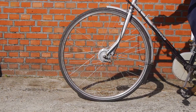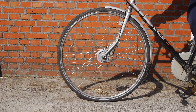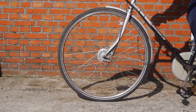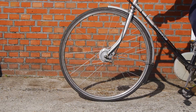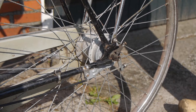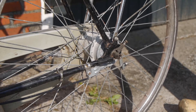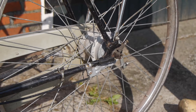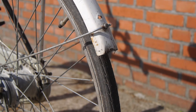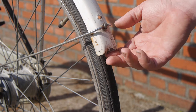Perhaps there is an issue with the crown, but for an amateur like me that's hard to tell, so I will have to try out a different fork. Also, when I have the drum brake apart, I can also adjust the cone to fix the play on this rear wheel. I do like this Sachs 2-speed, and when I am working on the drum brakes, I should also replace this mudguard.